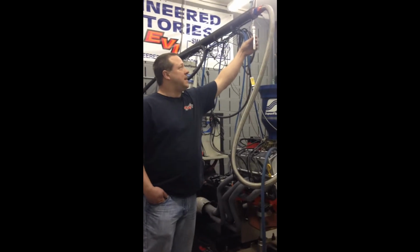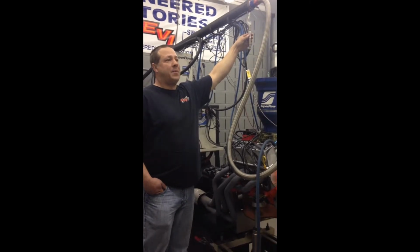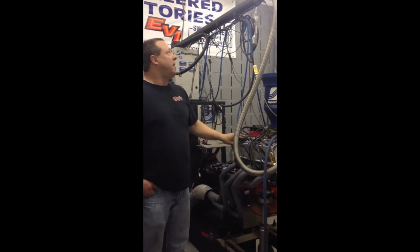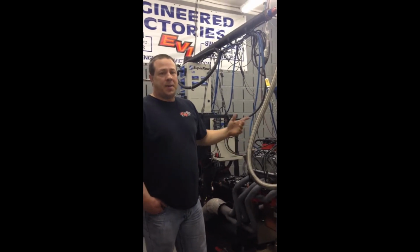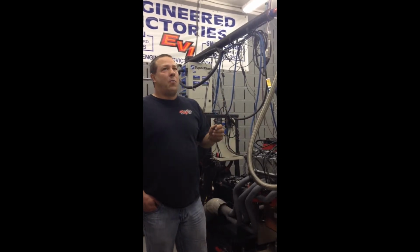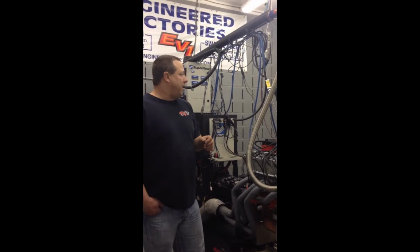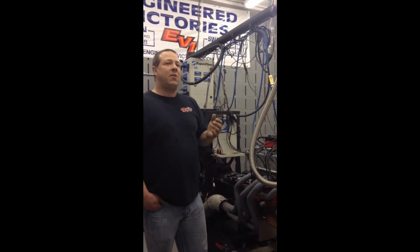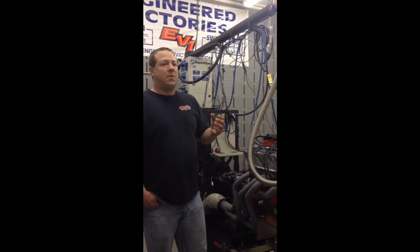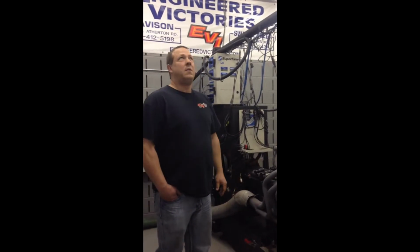This is the sensor that gives you the conditions of the atmosphere in the room, such as the temperature, the humidity, and the barometric pressure. Now, one thing that a lot of people have problems with is this guy's dyno says this and this guy's dyno says that, and his is wrong, or his is high, or his is low. That is more to do with the dyno cell itself and the conditions in the dyno cell than it is the dyno itself. It's very important to have a good dyno cell.